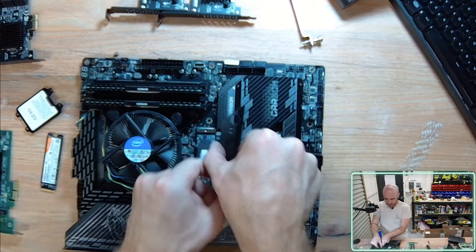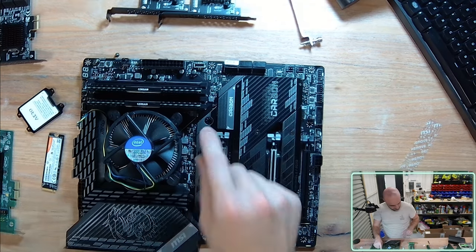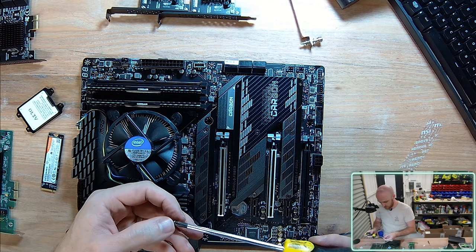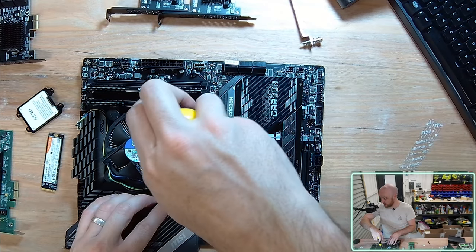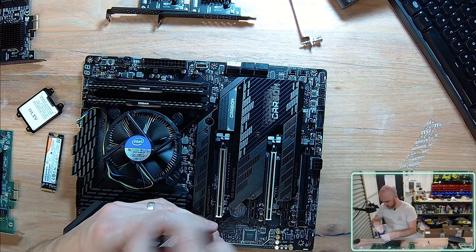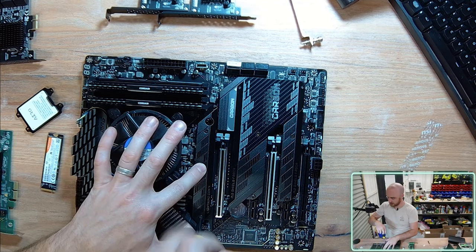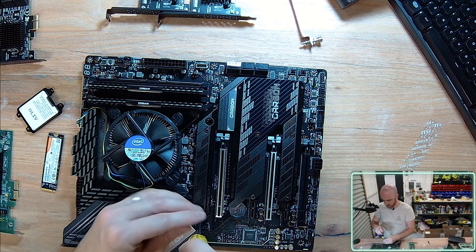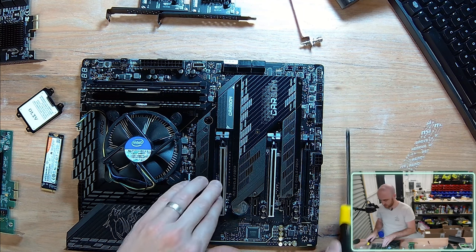Now let's just place that on top and find, I've got the screw provision there. I didn't pay attention to the greatest degree, but yes, I found the right screw. Cool. Just gonna screw that down. Don't have a good angle on that, sorry. I've got one screw over here. So there is that thermal pad on the underside of this metal heatsink here. That thermal pad is gonna transfer heat to this large heatsink. That will heat up and then be cooled down by passive airflow within the case. I don't know if passive airflow is the right word.